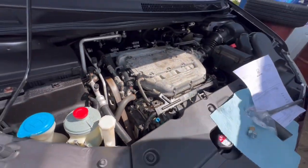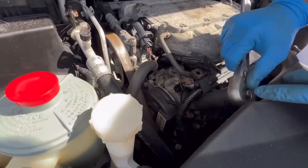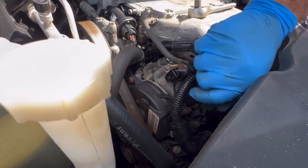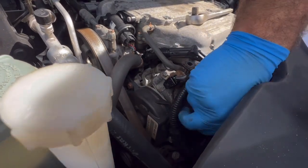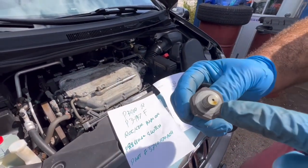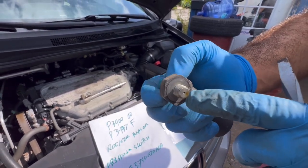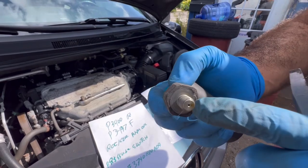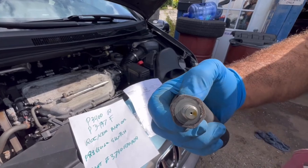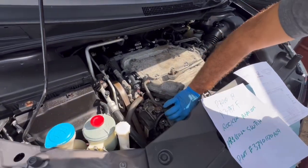Just to be safe, take the key out. When the oil is dirty, this little hole gets clogged and shuts down the pressure switch. There's no more signal to the ECM, and the ECM goes into a fault — it thinks the car has no oil and it starts skipping like a bad engine.